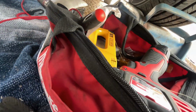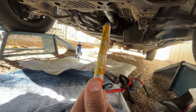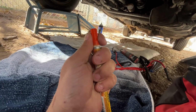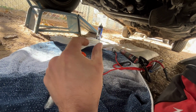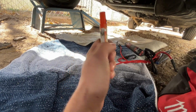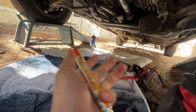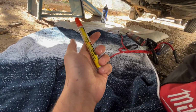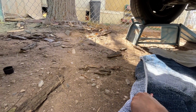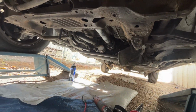And I have just about everything down here we're gonna need to disconnect everything and make sure we're all good. I have to mark all the weights and the angles of the little end caps to make sure I don't spin them the wrong way, because you do have to align the drive shaft bushings. They're not self-aligning for whatever reason. So I've got some towels down here on this horrible driveway of mine, and we're gonna crawl up underneath here and begin the process.